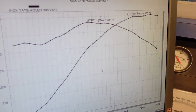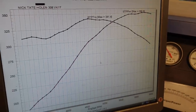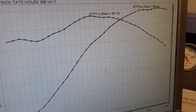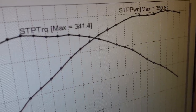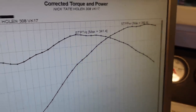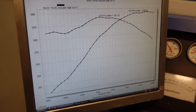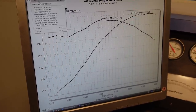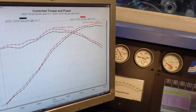So now we're going to put on the customer's 650 Holley Brawler carb. They can be a little bit hit and miss — I've found that in the past — but we might have to do some internal mods to it to make it something half decent. It would be interesting to see the comparison between the big and the small carb — a 950 versus a 650 — and this is not a big engine, but you would hope that the 650 won't shut it down too much. We'll have to wait and see.